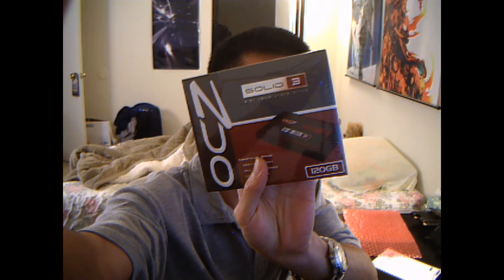Oh yeah, I guess the tech specs. It is a stock 3.3 gigahertz, 1155 socket. The K in the name, the 2500K, means that the multiplier is unlocked, so you have a lot more ease with overclocking. People have been hitting probably between 4.6 and 4.8 consistently with this particular processor. I'm hoping I got better silicon than some other people might have, so I'm hoping for maybe 4.7, 4.8, but we'll see what happens.